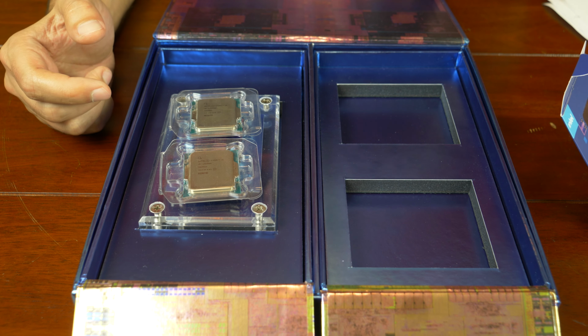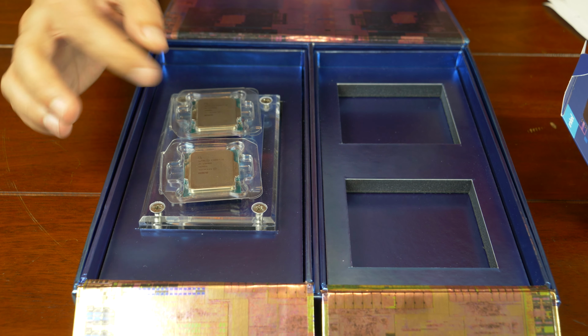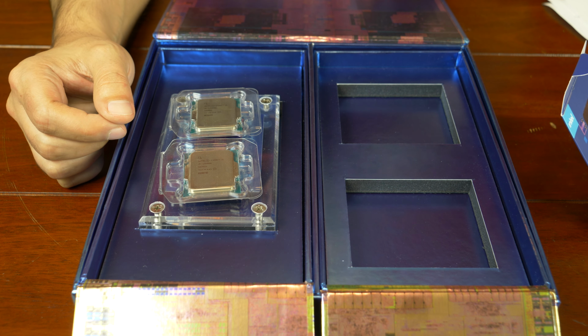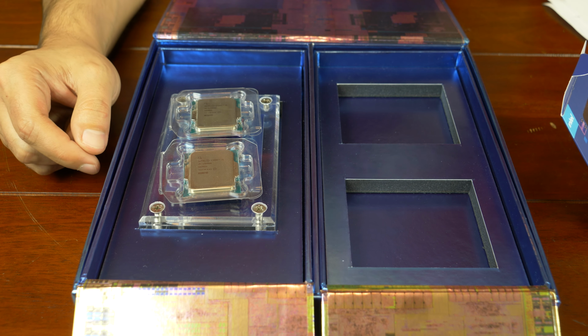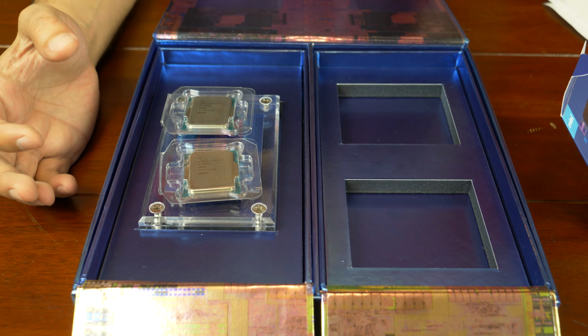That means your cooling capacity is one thing because it's a lot of wattage, but the area that can be cooled is also a lot smaller, where that heat's targeted. It's like a heat gun. If you wanted to melt down a motherboard and melt the solder on a specific inductor, you get a heat gun with a little tip like that that can do that. That's basically how you've got to cool the CPU, or what you're cooling at that point.